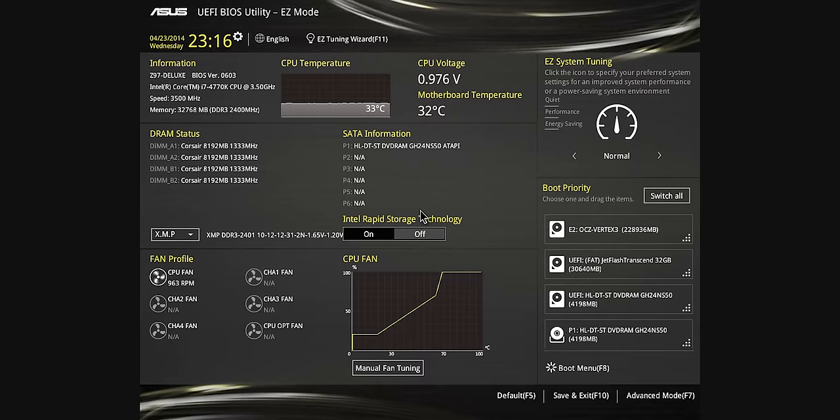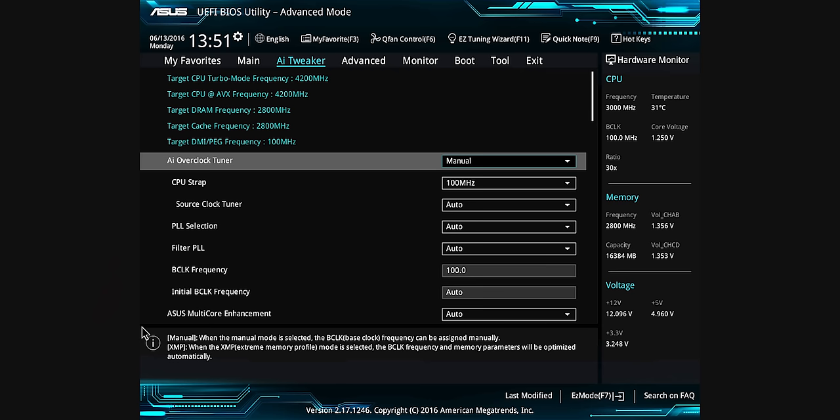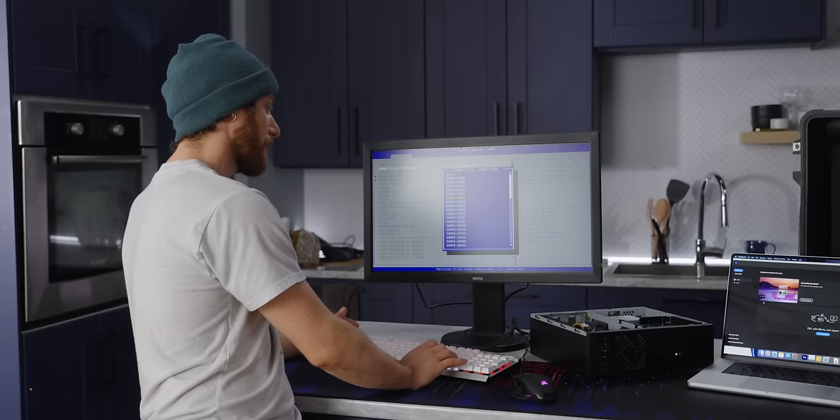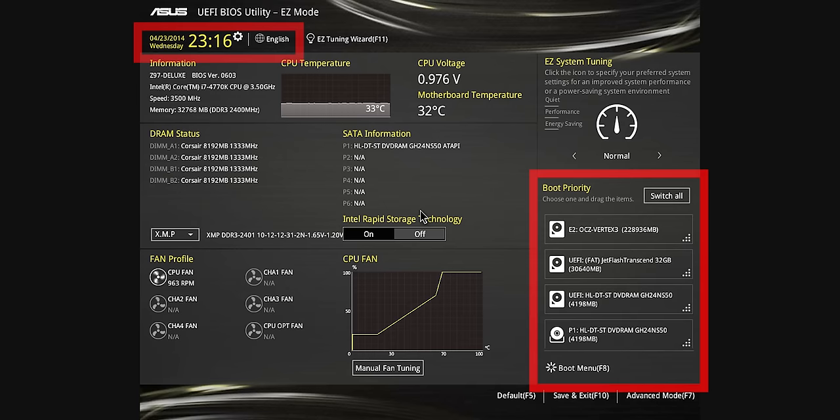The BIOS is the screen you go to when you power on your PC, and it usually has the logo of the manufacturer. There's a whole menu buried in here if you press the right key before your operating system starts to boot up — sometimes it's listed on screen, but it'll usually be Delete, F2, F10, or F12. If you're unsure, check your manual; failing that, just mash all of the above. The exact layout will vary a lot depending on the manufacturer and model year. The first screen usually has information about hardware installed, the date and time, and sometimes the boot order of storage devices. Before continuing, make sure that everything is showing up as expected — missing RAM, for example, could mean you need to reseat the module or the CPU itself.